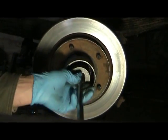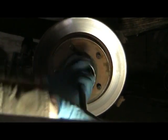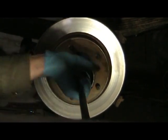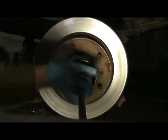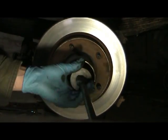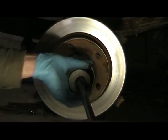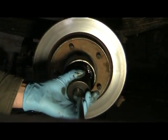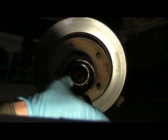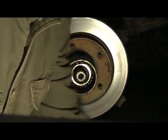That was loose — it didn't even require a breaker bar, which makes me a little nervous. On the other side when I was taking it apart I did find red grease, and it wasn't the good kind — it was the nice brown rust-red kind. So I know I was pulling water through either the spindle seal on the inside of this hub or through the hub itself, which I know had some rust in it, so either one's possible.